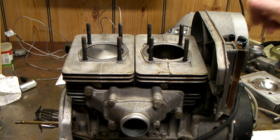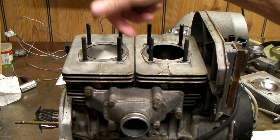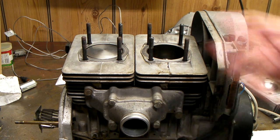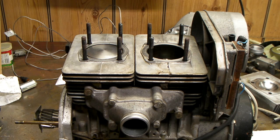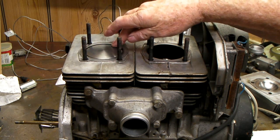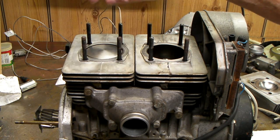By heating it up and then pushing the wrist pin into the piston through the bearing, then putting the snap ring in on the other side — whenever you fool with snap rings, make sure you've got those rags around the connecting rods. After that I pinch the rings together and oil up the piston a little bit.